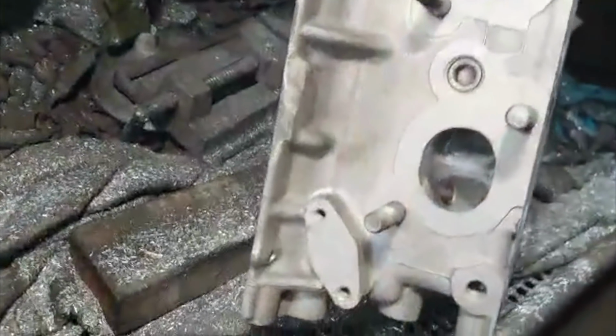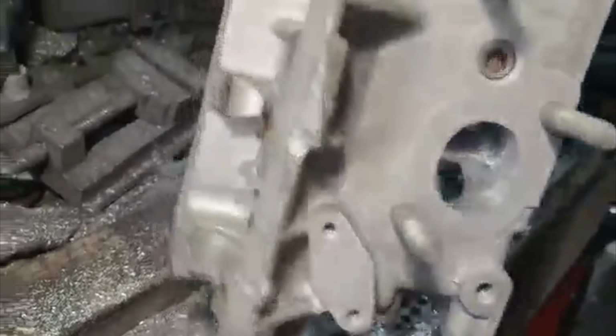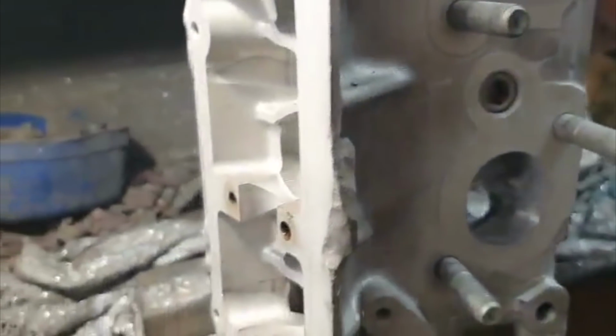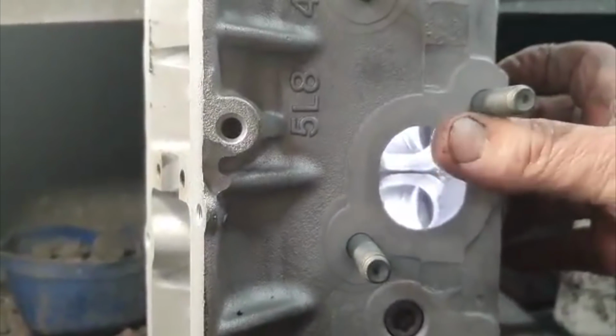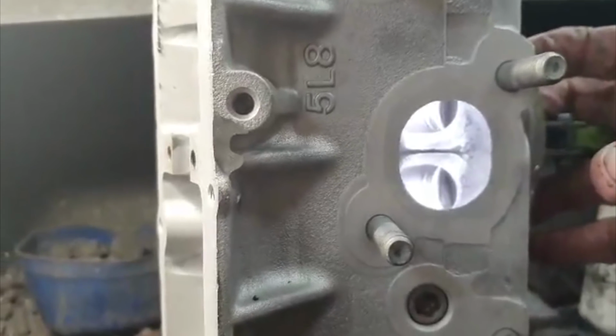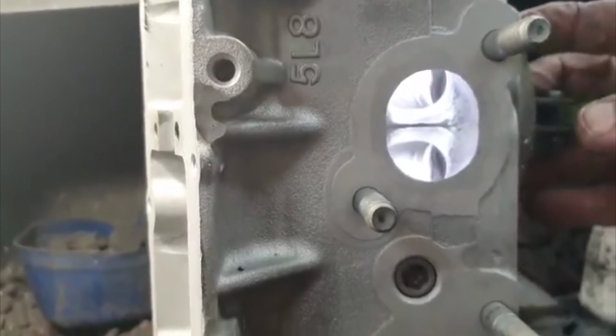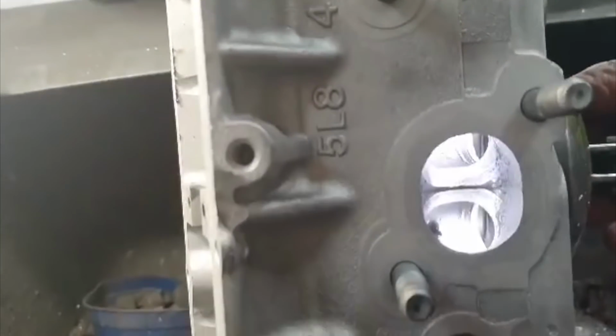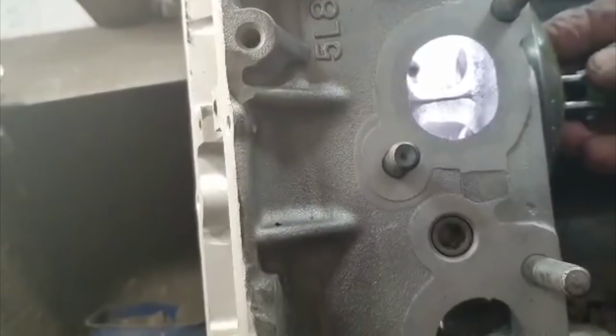So you should be able to see. Get rid of that bump. This over on one side, and we just follow that right through the port and knife edge the centre out. And that's the basic shape of roughing, and then after we'll polish it with the paper once we get a little bit more uniform shape on it.